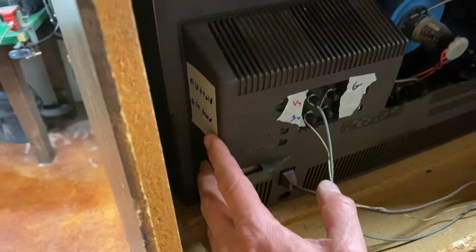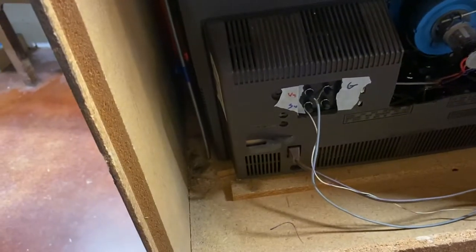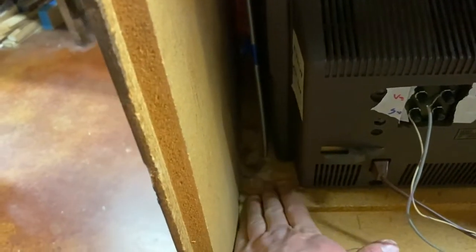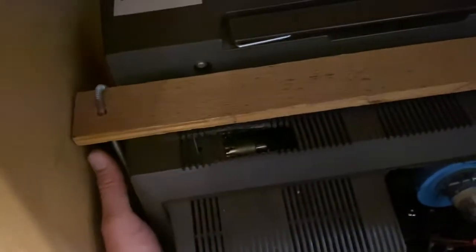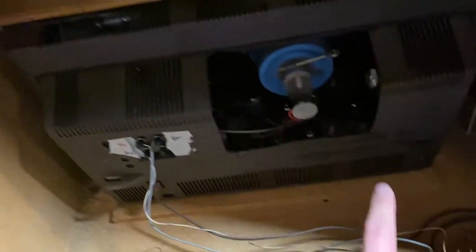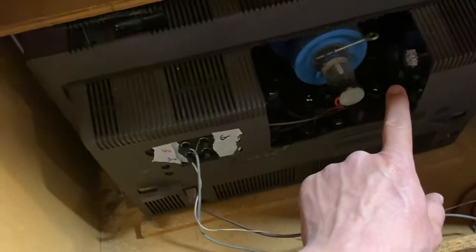Those adjustments were on the outside of TVs in the 70s. This is the original board, clamped down with two threaded rods bent over that go into a hole in the bottom. These holes were actually smashed out, so I had to re-glue one and put a block of wood with a quarter-inch plywood and drilled a hole through it so it had something to press on. I also put a washer on so this doesn't happen again. To get to that adjustment I have to loosen both wing nuts from the front side, pull the rod out, and then get my hand in to hit the vertical and horizontal hold. I replaced two vacuum tubes inside which allowed me to get the sound working and the hold working. It sometimes needs a little tweak, but not often.